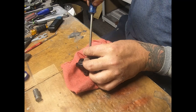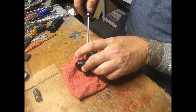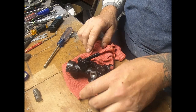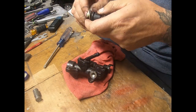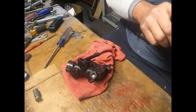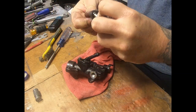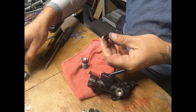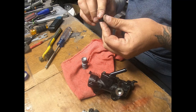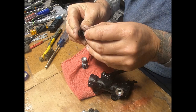If you'll notice when I took this piece off, I didn't move any of the threading. If you feel like you have to, make sure you count the threads where it was at — it's just for placement, where your switch was adjusted to. That's all the adjustment right there. This piece here — definitely want to get that nice and clean, then I'm gonna put some DOT 4 on it, get it all lubed up. There's a nipple on the underneath of it that goes right into the spring.